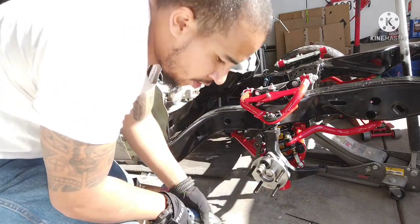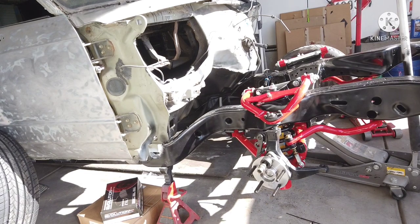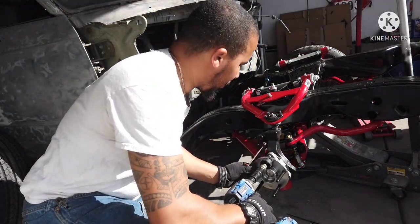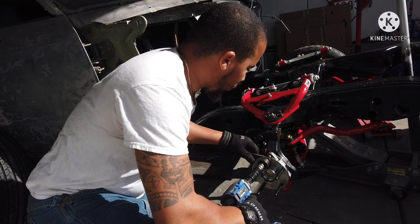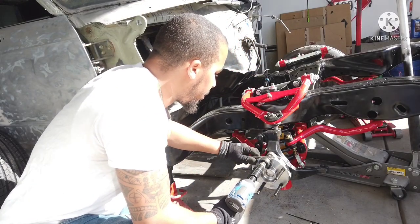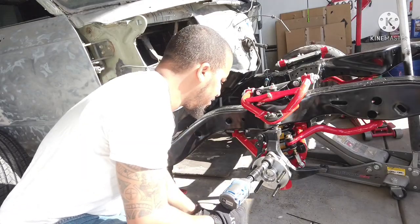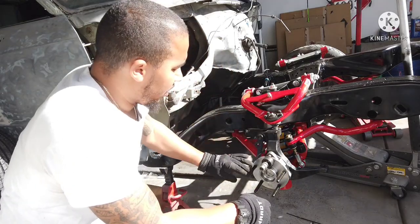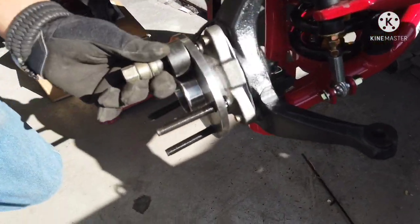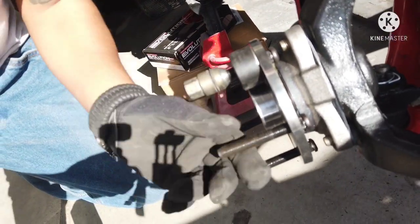I took the impact. I had a screwdriver on one — pretty much just getting it started. Have the screwdriver sitting behind it, putting some pressure on it so the stud's not spinning until it gets into the hub. That's as far as it'll go with this socket — I'm going to go get a deeper 19 millimeter. You can see it just pretty much pulls the new stud in, and they'll sit in place.